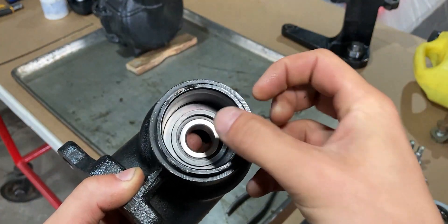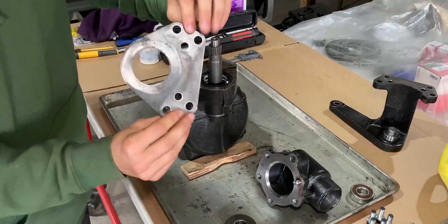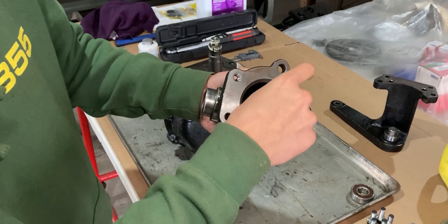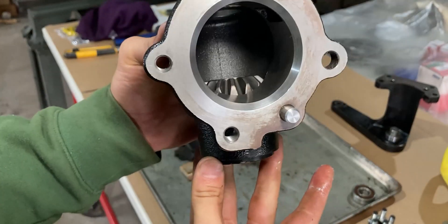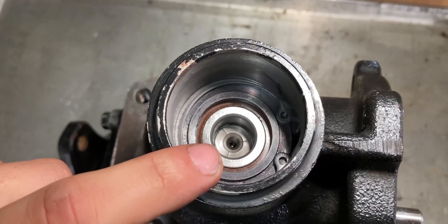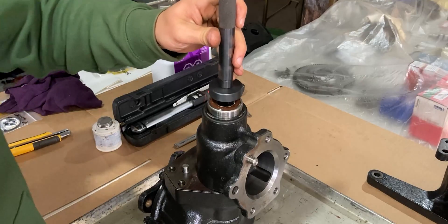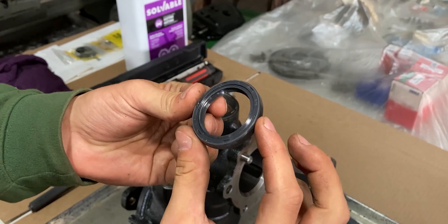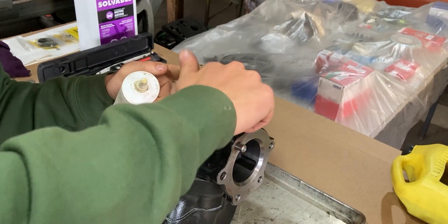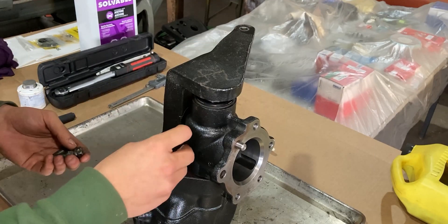What I have in my hand is the gear case drop housing — it's the part that holds the gear case and the steering arm onto the rear axle. To make it all work like clockwork, we've got a few more bearings and seals to introduce. Take a look at that shim — it's the key to getting those bevel gears just right. They need that perfect backlash, and this shim delivers exactly that. Now, that bevel gear I placed into the drop housing — it's time to slide that onto the top end of the shaft gear. A gentle tap and they're a perfect match.